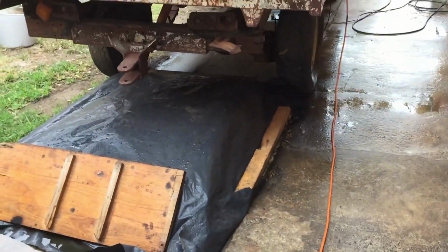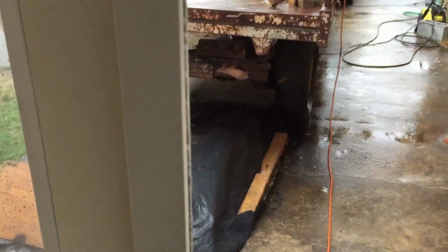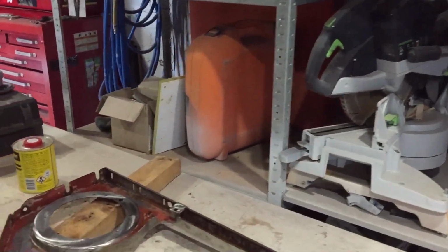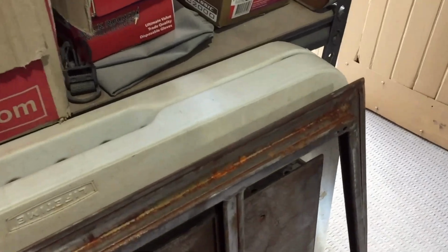And then I've made myself a new molasses pit, a little bit more discreet, a little bit smaller, because I don't need to put the bonnet in or the roof. So I've got the, what have I got in there? The right hand door, top door frame, and the mesh grill. Both doors are finished now, fixed up all the rust, tidied up the top frames. This is the mesh grill out of the donor vehicle, just had to weld up the patches that had sort of fallen out. So I'm going to put that in the molasses.